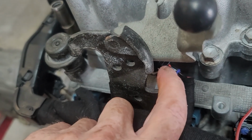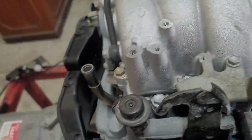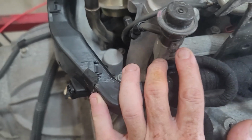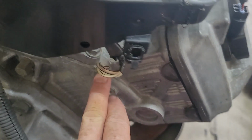Okay, don't forget about this little valve under your engine cover mounting. There's a little 2-pin connector over there. That's for your variable intake length actuator. Just make sure that is plugged in. It gives you better torque. Okay. And then this is obviously just a noise filter. You've got one of those on either side of the motor. Earth strap on this side and on the other side.